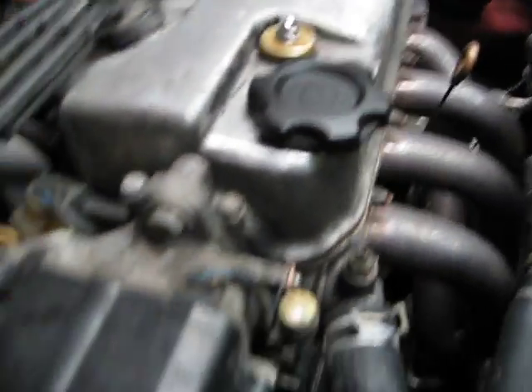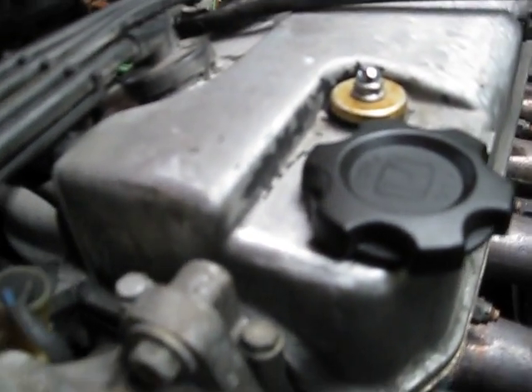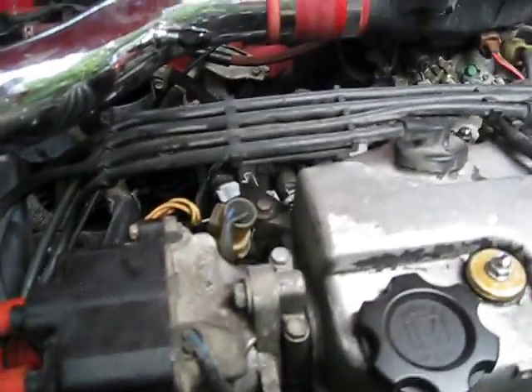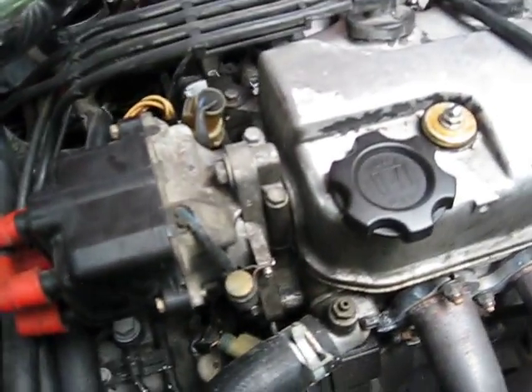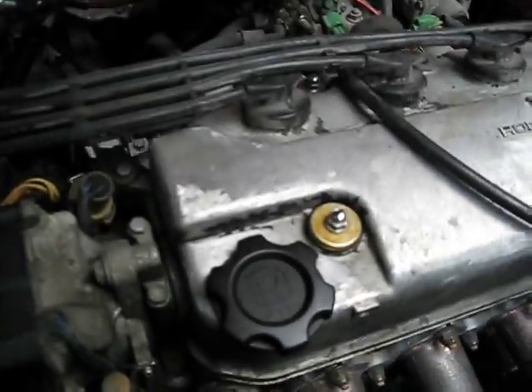Down in here there's a thermo sensor and an O2 sensor, plus some plugs — all of this is going to have to come off. Same with the distributor: pop these two connectors, take out the three bolts that hold it in, and the distributor will come out. It only goes in one way and only comes out one way — if you put it in wrong it'll sit sideways, so it's pretty easy. After you get all that done, you're ready to take it to the machine shop.